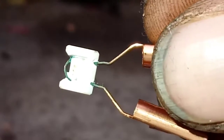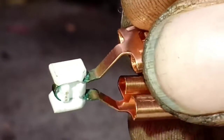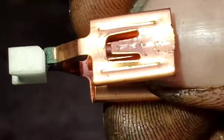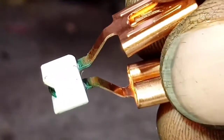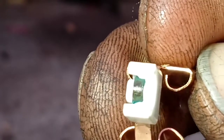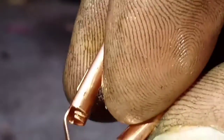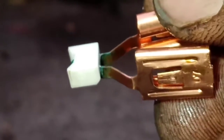Focus. Yeah, it's literally all there, all the corrosion just in there, and that's so difficult to spot with it actually in the casing, with it in here. That would be nigh on difficult to pick up. You'd see it from the top, and that's what gave me the alarm bells. But only when I took it out, even though it still works, it's not blown, it's not broken, but that's going to cause you some problems. So yeah, be extra vigilant when diagnosing electrical systems. Very, very vigilant.